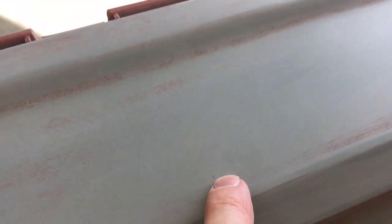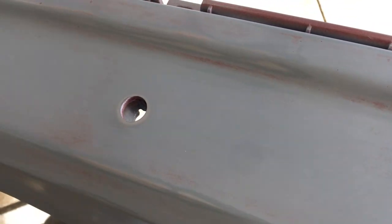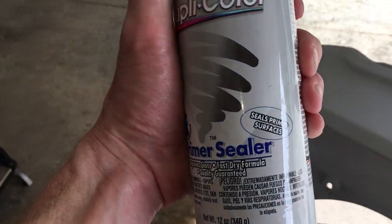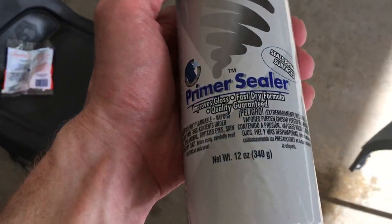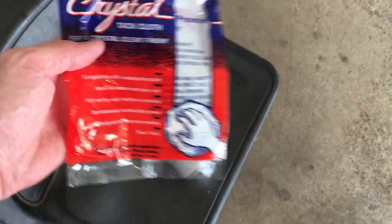That took forever. I had to go back down to 100 grit and work my way back up, so I'm never using a non-sandable primer again. But it did the job - here are a couple more tiny imperfections I wouldn't have seen otherwise. Now I have a surface of sandable primer, filler primer, and OEM paint. I have primer sealer to give one consistent finish, which is ideal before laying down the color coat. Before I apply the primer sealer, I'm going to wipe the surface with a tack cloth to be sure any debris is removed.